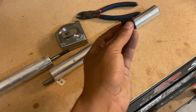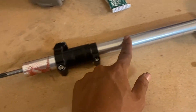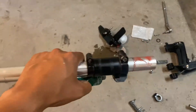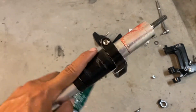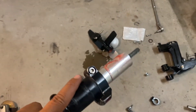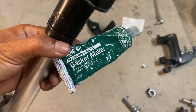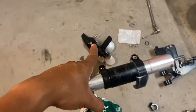There are three bushings inside the tube, so just cut a portion off and try to miss them. The bushing can actually move around if you knock it up and down, so it's really not a big deal if you get close to it. Now I'm going to start reinstalling everything — I'll put the main tube into the lower unit first. Since the original company used RTV to seal things and prevent water from getting into the lower unit, I'm going to redo that with some new gear-oil-specific RTV.